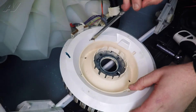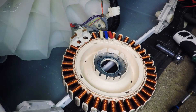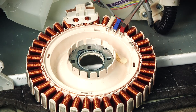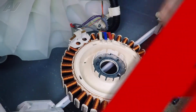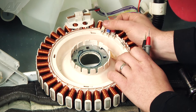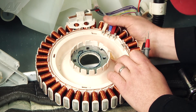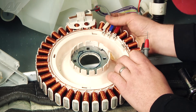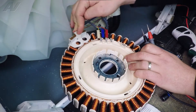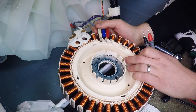There's one on this side too, and then it'll come off. Here you can see we have our wiring to the stator. We're going to disconnect our wiring going to the stator right here. This is the RPS sensor here, and now we're going to be checking the stator for resistance value.